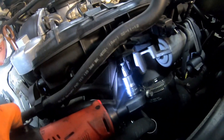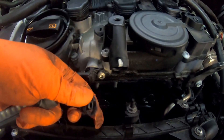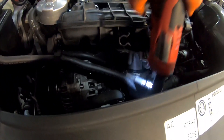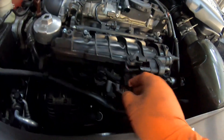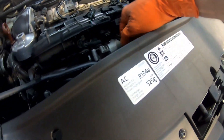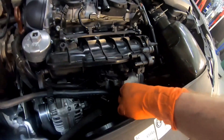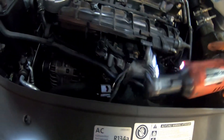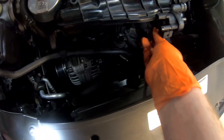Same T30 bolts again and then there's just one underneath the front here. I've got the EVAP pipe off and unplugged, and the breather pipe off from underneath the manifold. The boost hose from the throttle body is a 7mm. We're going to unplug the intake air temperature sensor and the throttle body, and feed the wiring out underneath - the wiring harness stays with the engine while the manifold leaves it behind. It is quite tight around the intake air temperature sensor, so I undo the T30 nut, spin the sensor, get the wiring harness out from behind it, then replace the screw so we don't forget it.